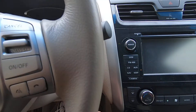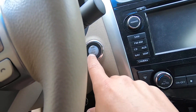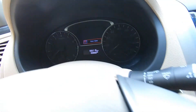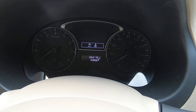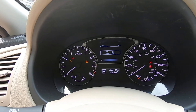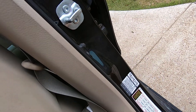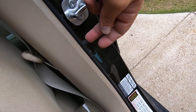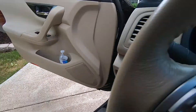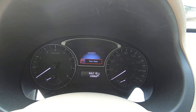What you do is you turn the key on. Now this has got the Intelligent Key, so it's just got a fob. As long as you have the fob on you, turn the key on without starting it — don't have your foot on the brake — push the button twice. Your instrument panel should light up to let you know that basically the key is on. Then you're going to push your door switch 10 times, then turn the key off, turn the key back on — two pushes.